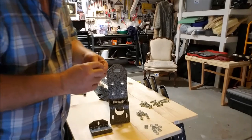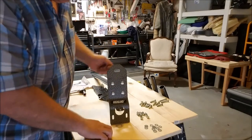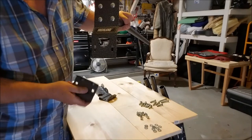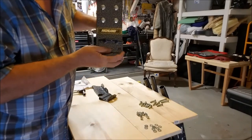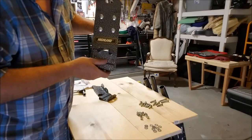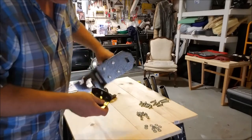So let's get this loosely bolted. This is where your eight one-inch carriage bolts come in. For each connection you're going to need a carriage bolt, a locking nut, and a washer. Remember the sticker — it's just going to sit on there like that. Stick your carriage bolt through the bolt hole, put the washer on the back and the nut on the back, and just finger-tighten those on all eight slots across all your tubes.